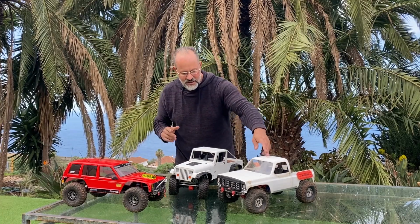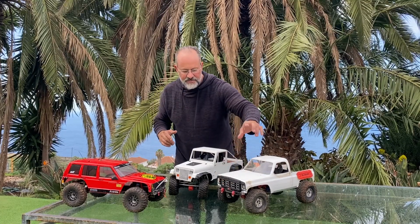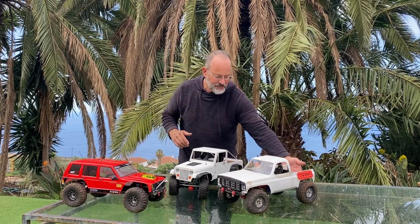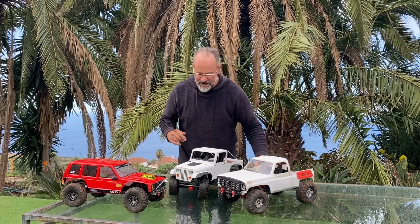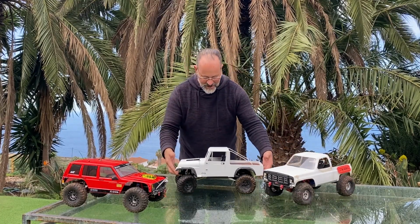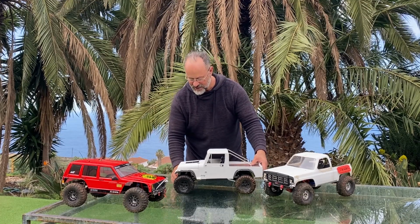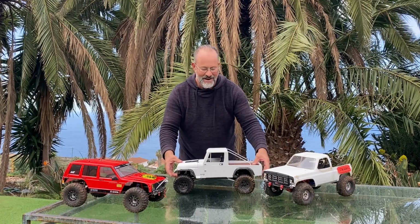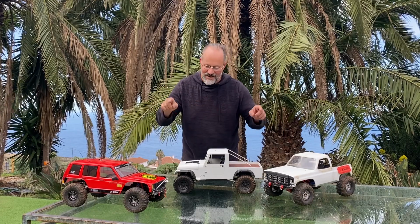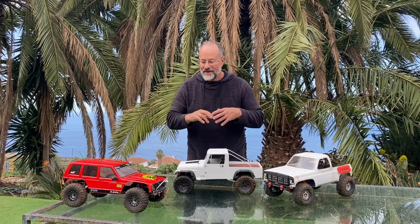The Blazer, you've seen it on the show, I have no suspension in the front at all. I have the Penhack on the front shocks that don't allow a lot of droop on the front axle, but we have a lot of droop on the rear axle. This truck, compared to these, can still go down into the suspension, allowing me to go over obstacles, like creeping over an obstacle where these two trucks actually get stuck. And sometimes they get really stuck and we have to winch them out.